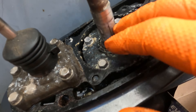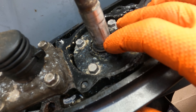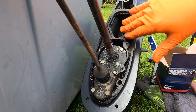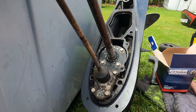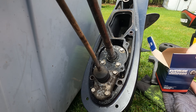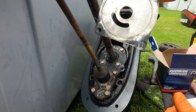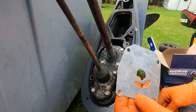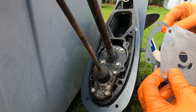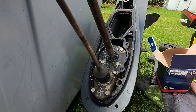Without the wear plate this is what it looks like — you've basically got your water seal for the gear case there, and we'll build it from scratch. Starting from the bottom we've got the gasket and the wear plate. A good tip is to use the old one as reference for how it came off — as we can see, the gasket is underneath and that's how it's lined up. So put the gasket on underneath, get it turned around right, and set them over the top.